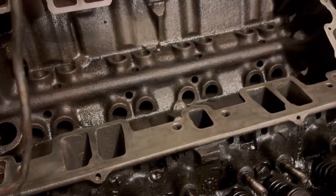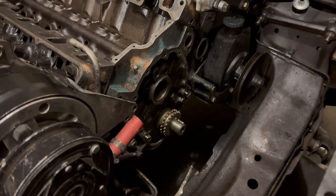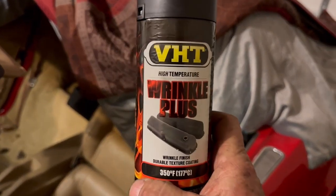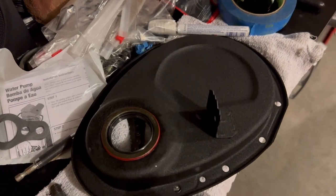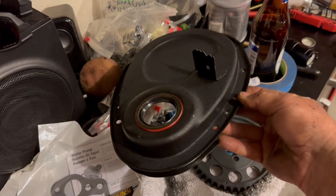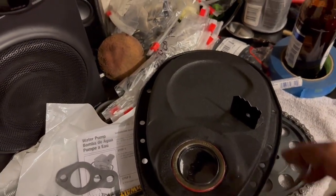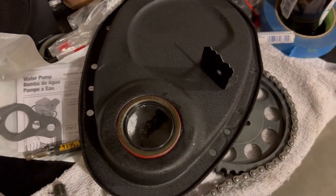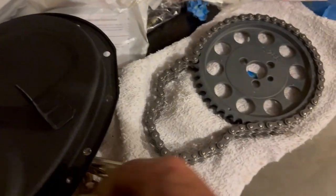I got a new water pump. I cleaned it up with brake clean and painted it with high-heat wrinkle-plus high temperature wrinkle coating — it's in the oven baking at 200 degrees. I also did the timing cover: cleaned it with a wire wheel on a die grinder, sprayed it with wrinkle seal, baked it in the oven for an hour, and then put the new seal in it.